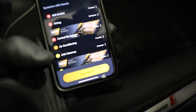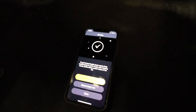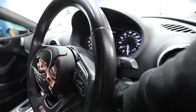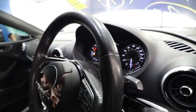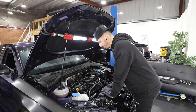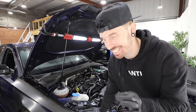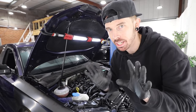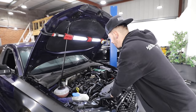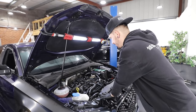It's now got good coil packs, good spark plugs and good injectors. Next thing is to clear the codes and start it up again — fingers crossed that works. This has happened before and it's deceived me, I celebrated way too early. So let's just wait for the cold start to end. And sure enough, after a few minutes once the cold start had ended, the misfire began again.